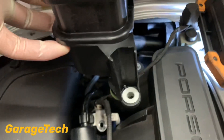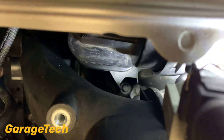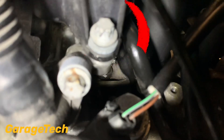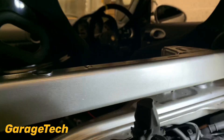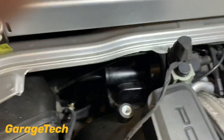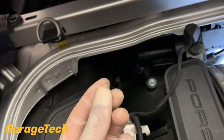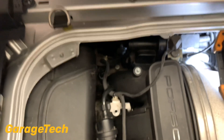There are two E10 bolts and I'll just about show you where they sit — it's quite hard to see, just down there and the other one's just there. So those are the two you need to remove. I'm going to go ahead and remove these. The trickiest bit is actually getting the valve out — that's the tricky bit. You don't need to remove anything else. It's a bit like playing Tetris. I've got a pair of gloves on to keep my hands clean.